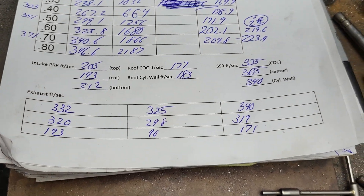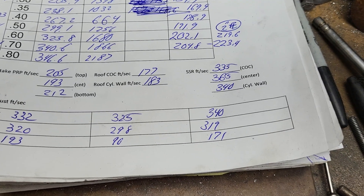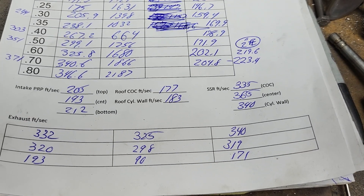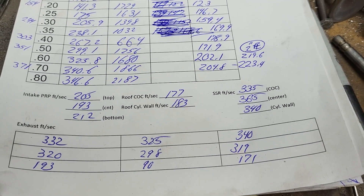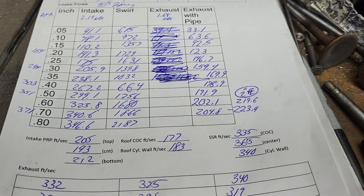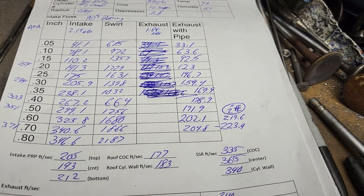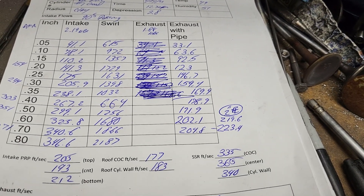Take a quick look at our exhaust speeds. In the big scheme of things it's really not that bad — yeah, it's completely dead in the middle but it's relatively even side to side throughout the port. It only starts working at those numbers at 600 lift. The exhaust port really isn't good anywhere for its size and a 1.88 valve — that can be improved a huge amount.